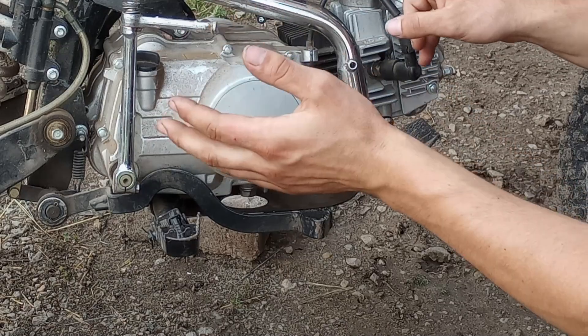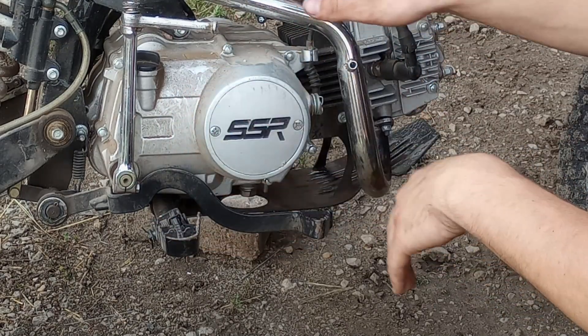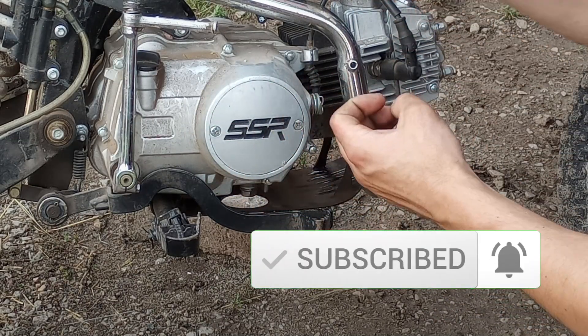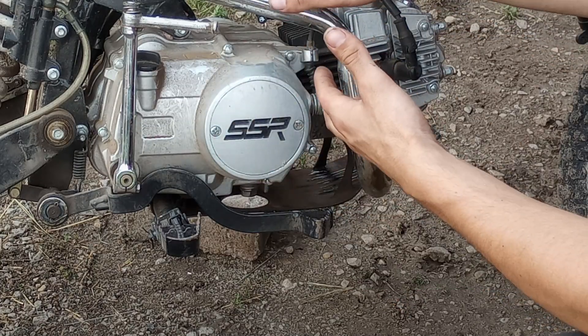I put the Nibby 22 millimeter — it's a PE 22 millimeter. If it has 'FL' at the end, that just means it's a flange mount, which uses two bolts. They make the same carburetors in the rubber spigot style as well, so for a direct bolt-on you're going to want the FL version.